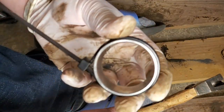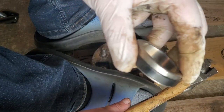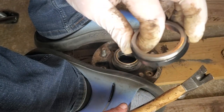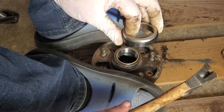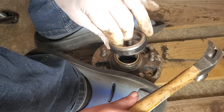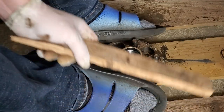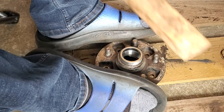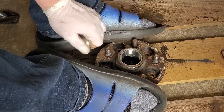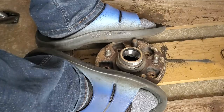I like using the skinnier side facing down toward the bearing and hammering on the thicker side, because this side is rounded and tends to flip like a coin if you hammer it. The zip tie really helps keep things aligned and also acts as a handle once it gets a little farther in. Once it's too far in to use the zip tie, go back to a block of wood, but keep the old bearing on there to press it in past the lip. Keep going around until the bearing race is fully seated.